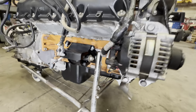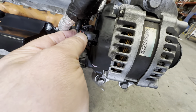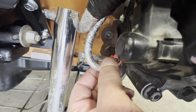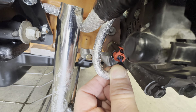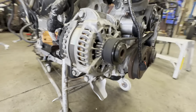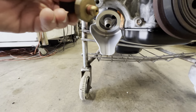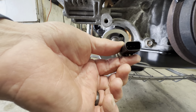Now let's talk about wiring. Here is the alternator wire, which looks like an injector plug — it's plugged in right here. Right here is the oil temp sensor, which looks like the coolant sensor wire. The sensors look the same, so here's the coolant temp sensor. And right up in here is the oil pressure switch — this is what the plug looks like. It's up inside there.